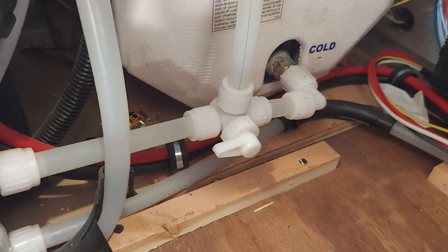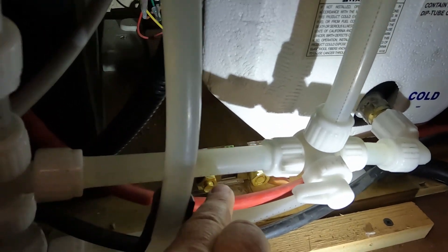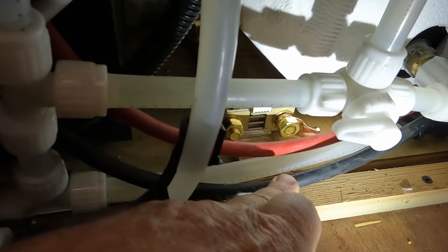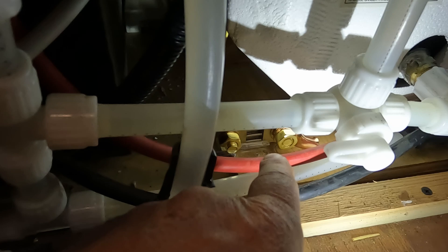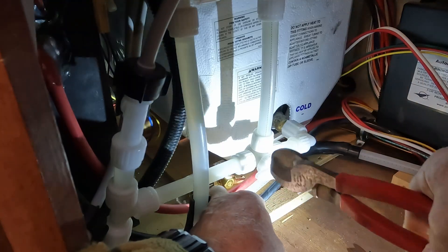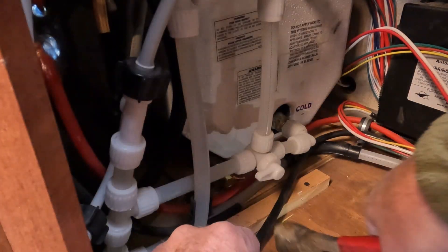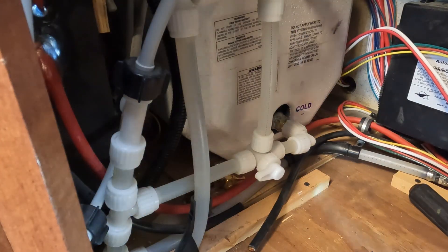We'll just play around with it and see what we can steal for power. Thanks to the woven light, I've got plenty of light here. There's my shunt up near the hot water heater — battery positive, battery negative. If I cut my battery negative here, put my lugs on, and land them on the lugs of the shunt on either side, we're in place. Then all I have to do is put a screw straight down into the wood. I think we're in business. We're going to cut this cable right here.